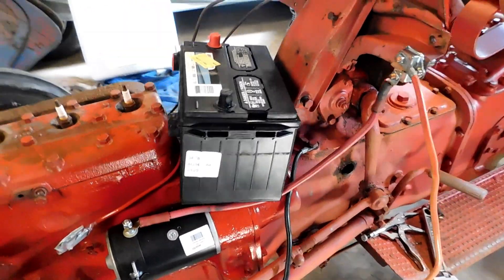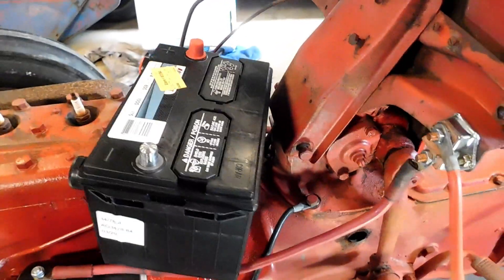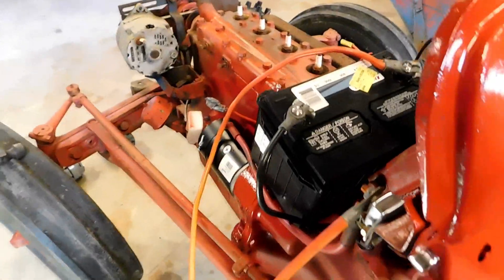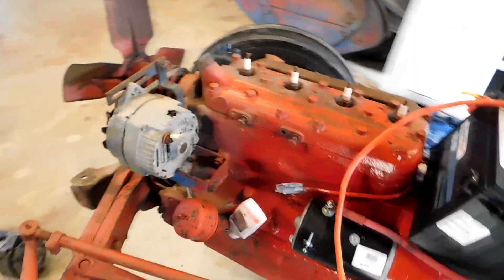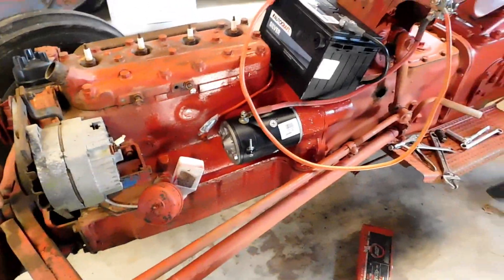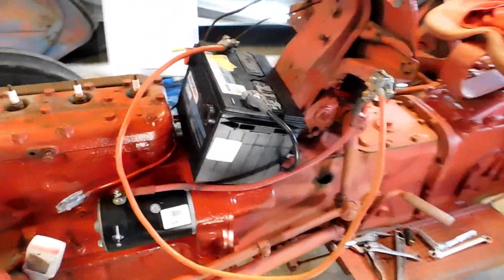I've got my brand new battery. This is going to be the first time this motor has cranked in probably quite some time. Let's pull the plastic tabs off and get our positive side on. That one's probably tight enough. Let's see if she'll crank over. Sounded good to me — sounded nice and solid. Starter's doing what it's supposed to be doing. Before I put it on there, I rolled the motor around just by hand and didn't see any messed up teeth or anything. So we are looking good.